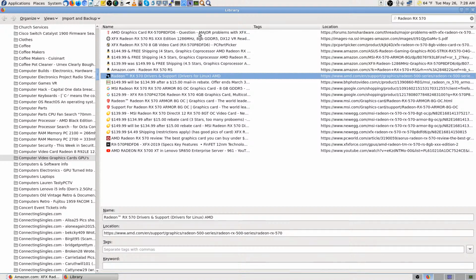Okay, so oh yeah, and I have to get a cable, because I'm going to need a long cable. The cables that come with it wouldn't work anyway. They have an 8-pin to 6 and a 6 to 4. I think they're giving you something so that you could plug it into a Molex, plug those two together. I've seen pictures of people doing that, which I guess is fine as long as your power rail can support 150 watts on your power supply. But if you've got all Molex, you don't have any of those 8-pin connectors, and you probably, well, no, that's not right, really, because they've always sold big power supplies. I guess that's why they do that.